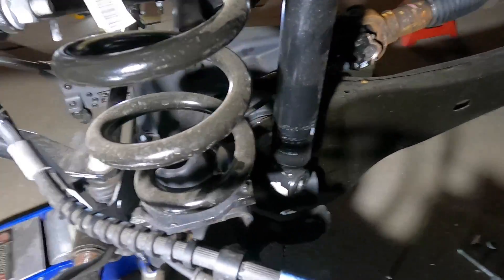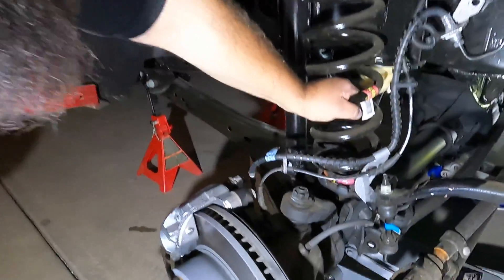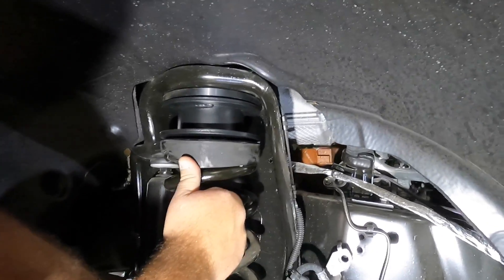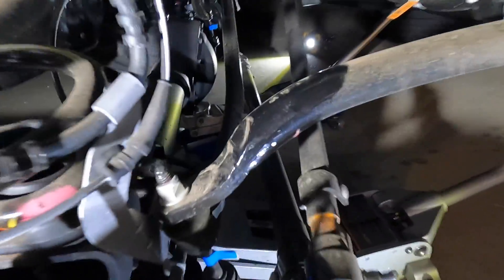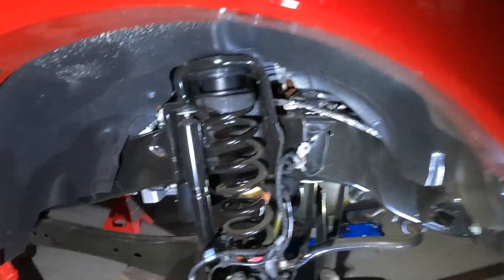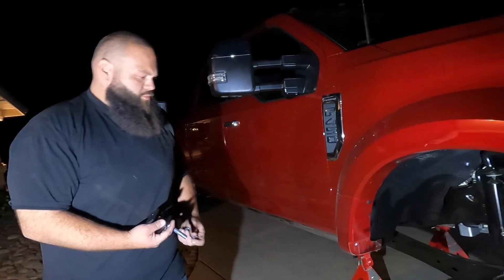Make sure you twist the coil spring so it locks into the axle bucket right here. Let's jack up the other side. Make sure that centerpiece is in — that's the little spacer. Check this side too, then give it a couple jacks. There's a lot of rust in this thing. So we're going to add these shock extensions temporarily and we're good to go. The ride on the last few I did was very similar to stock — stiffened it a little bit just because of the added load on the spring.